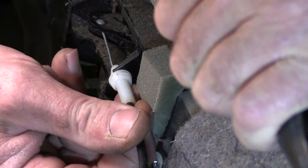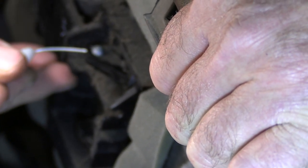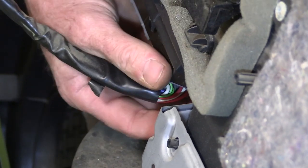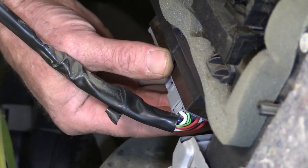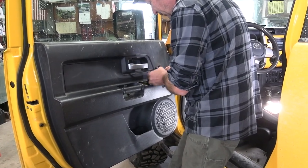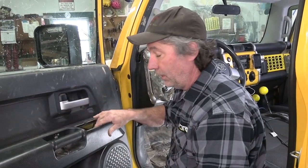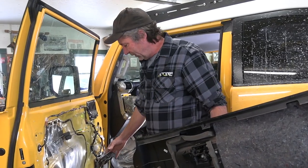Same thing up here at the top — pull this white thing out of there and move your cable so that that wire comes out through that channel and the ball comes right out. Instead of fighting to try to get this wire plug out of here, we're going to take this whole assembly and take it out from the other side of the door panel. There's a little clip at the top — press that in, push, and we can just turn it sideways and push it through the hole. So it is now completely off, and there's our controller hanging there.